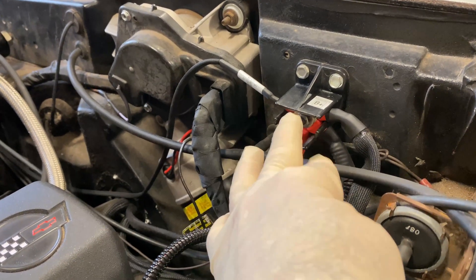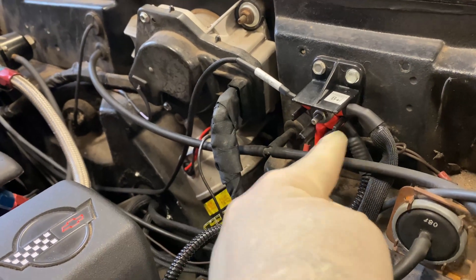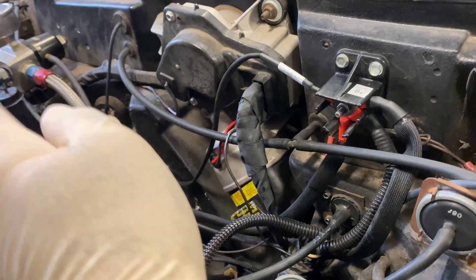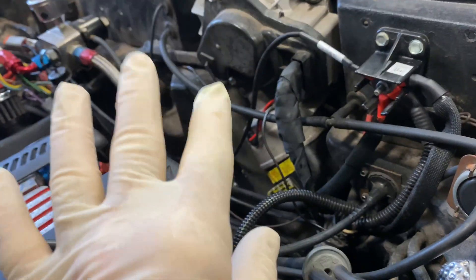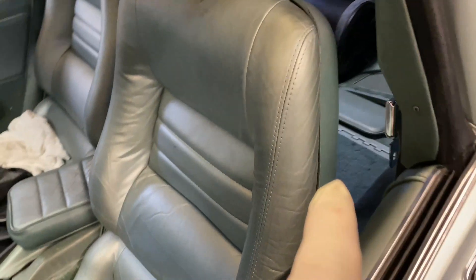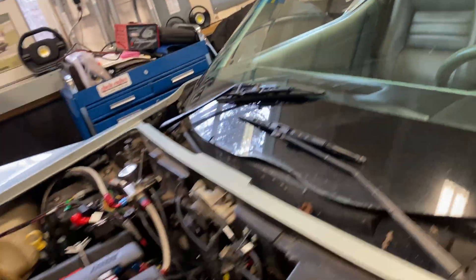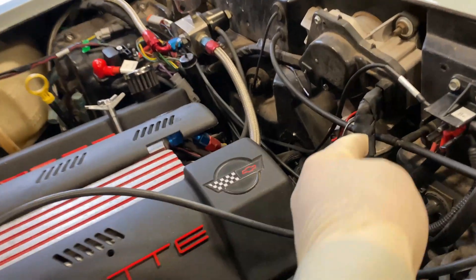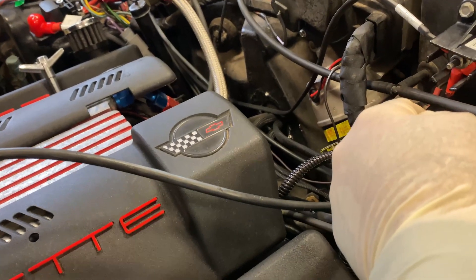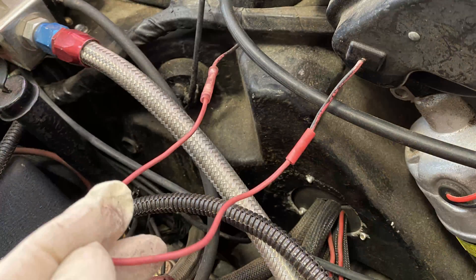This was put on afterwards. When you turn the key, this will be a key accessory — it'll be active. It helps with their wiring setup. I didn't spend years knowing exactly where every wire was and what the source is, because they have a lot of fuses back here where the battery is. It's working, so I wasn't going to deal with it — that would add hours when it's working now. I improved this wire here — it just looked bad to me. This is the key-on to the fan relay, and that fan relay has a positive power.